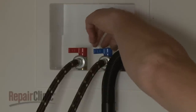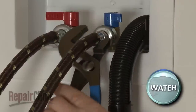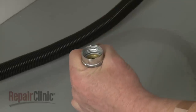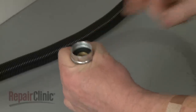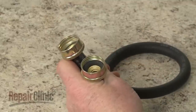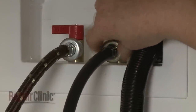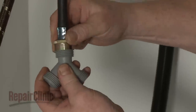If the dryer model uses steam, your next step is to turn the cold water faucet off and disconnect the washer inlet hose from the faucet port. Remove the old rubber washer from the inlet hose and replace it with a new washer. Insert new rubber washers into both ends of the provided 2-foot inlet hose. Now thread the 2-foot inlet hose onto the faucet port by hand until snug. Thread the opposite end of the inlet hose onto the short end of the Y connector.